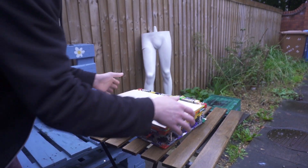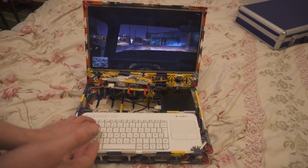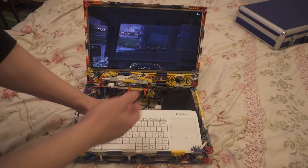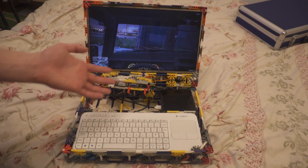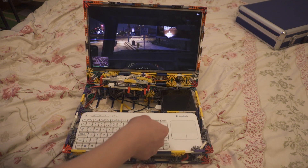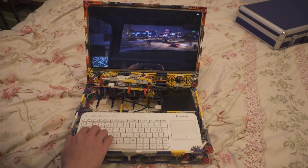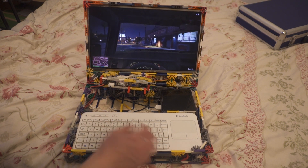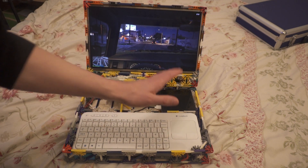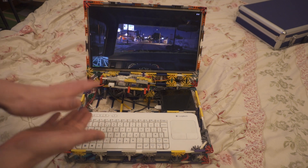Let's shut that down now. The main downsides of a setup like this is that it might be a problem sometimes to check your battery — right now I'd have to pull the keyboard out and maybe put a mirror here to see how many lights are left on the side of the battery. You don't have the integration of a battery monitor. But that can be bypassed with this battery, as you can run a pass-through and have the whole thing being charged whilst being used at the same time. Another downside is the bulkiness and thickness, because every component has its own case — the NUC, the keyboard, the battery — and putting all the separate bits together makes it a little thicker.